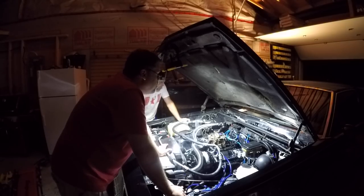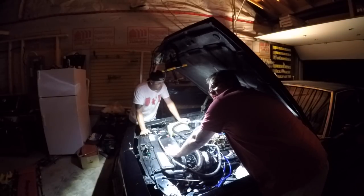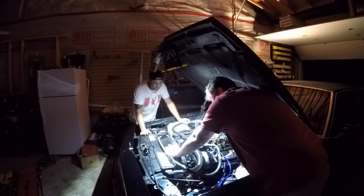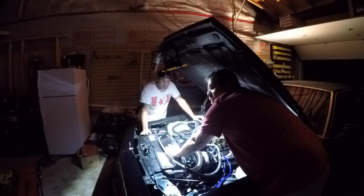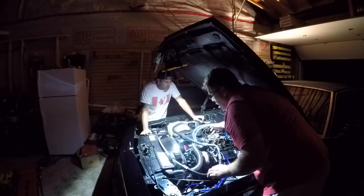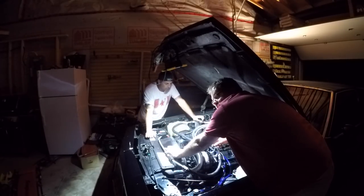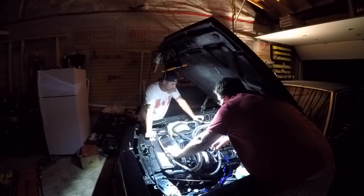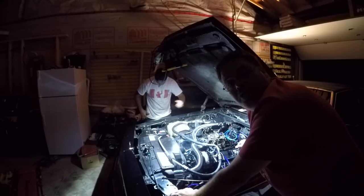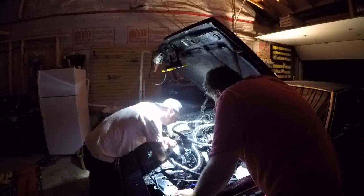We're going to run the wires and make sure they're not anywhere where they'll get eaten and stuff like that. I'll be totally honest with you — I did have the firing order right the first time, did I not Brian? Yeah. We did fire it up but we had two issues: we had a little richness going on and we had a vacuum line on the secondary squirter on the old Rochester carb causing it to run a little rich, so we fixed that line. And like I said, we had a little leak on the old thermostat housing because Brian cranked her up a little too much — the old torque wrench arms there. And then this hose blew off because you forgot to tighten that, so that's why she's wet boys — we had to take her outside and hose her off.